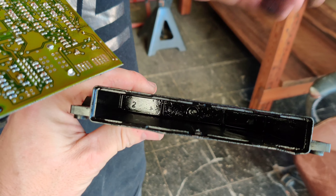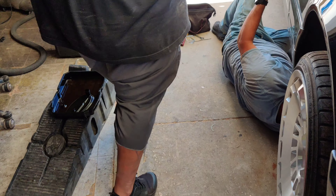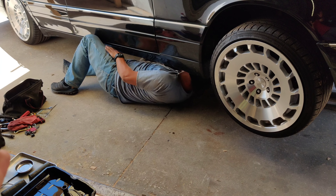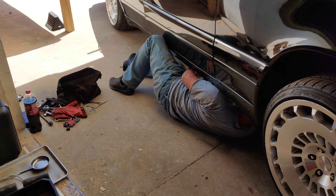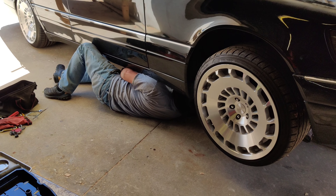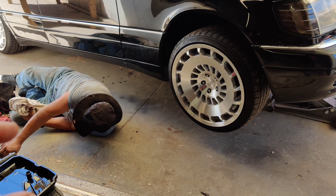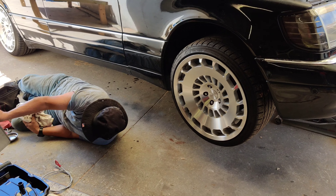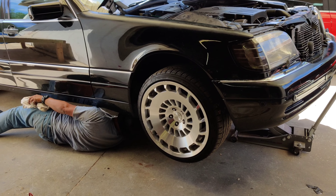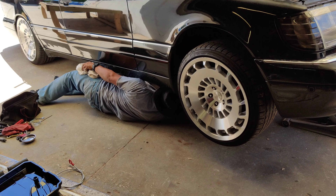When he pulled the TCM out you can see oil in there, which is telling us there's an issue. Manny's down there taking off the transmission plate cover — he's already drained the fluid. He's going to show us exactly how to swap these conductor plates out. It's very inexpensive but very common on these transmissions. They will jump into limp mode, which won't allow you to drive at full operating speed. Make sure you can support your vehicle properly before sliding under there.